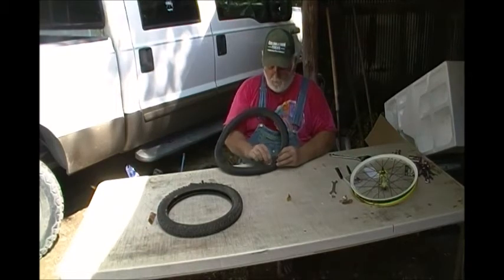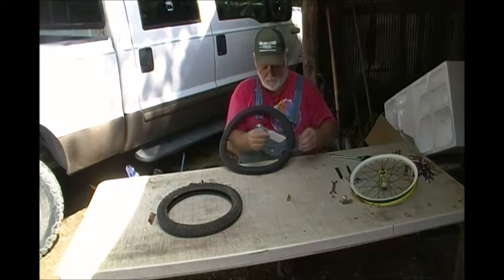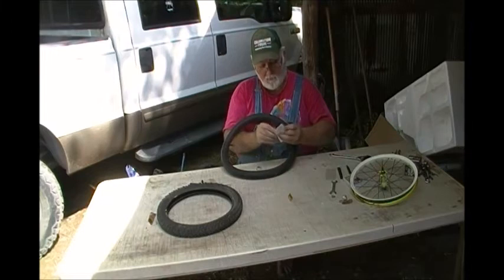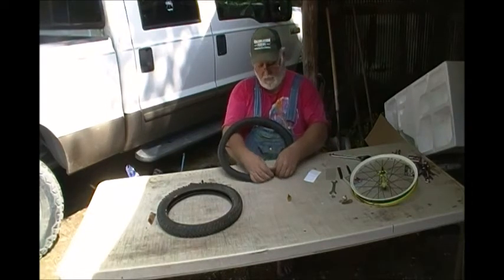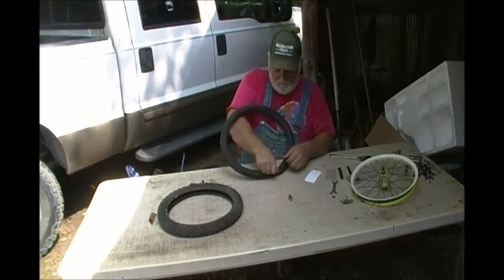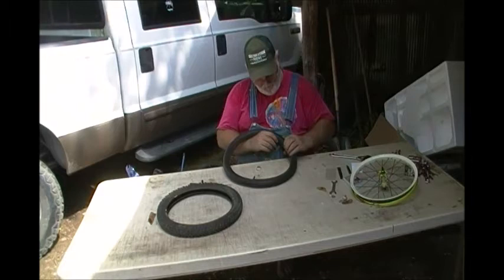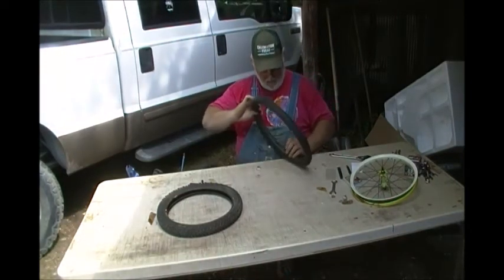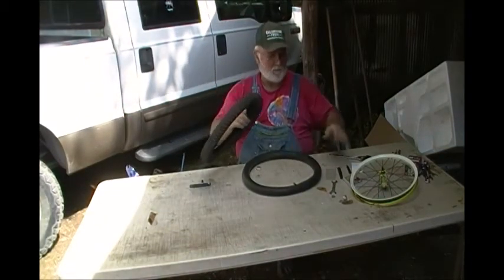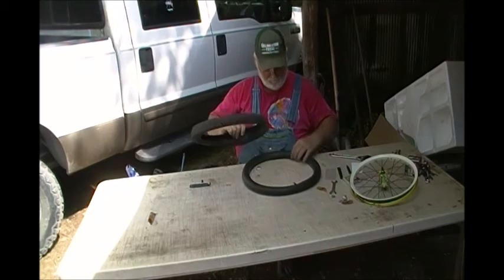I've scraped the area quite well around that hole. It says just don't touch the adhesive side — just peel it and stick it on there. That's all — like putting a Band-Aid on it. The patch is clear; you can't even see it. The thing about patching an inner tube is that this is inside the tire. When you inflate it, it's not going to stretch out of shape. It's going to conform and go up against the wall of the tire, so it won't stretch any further.